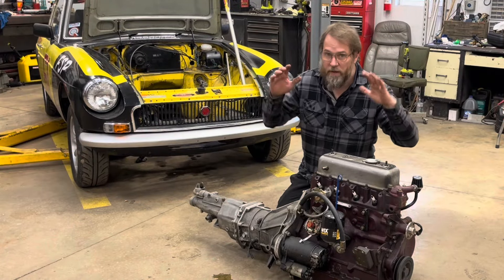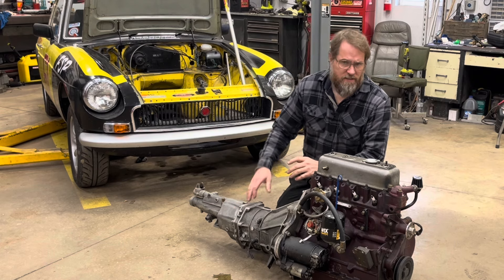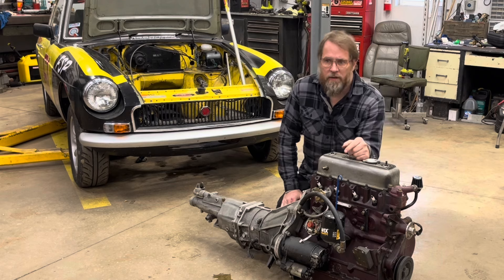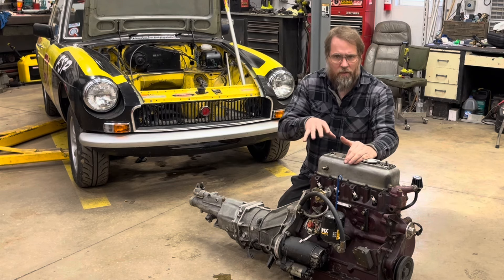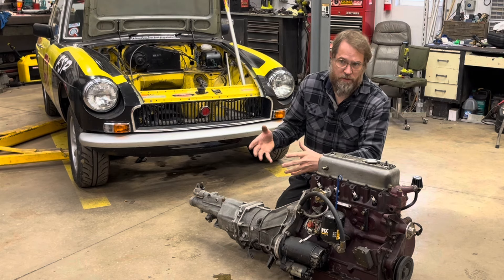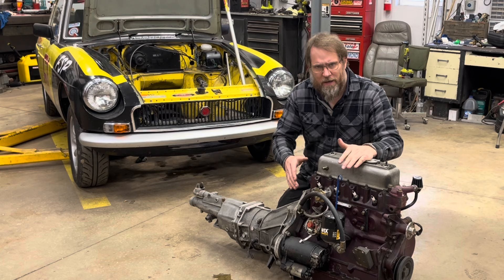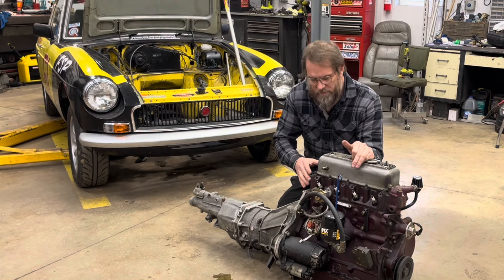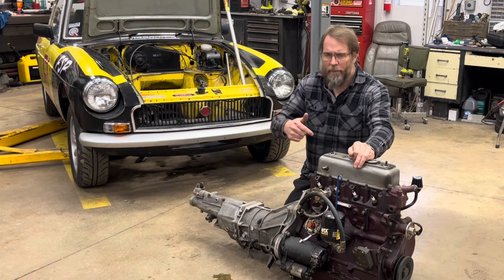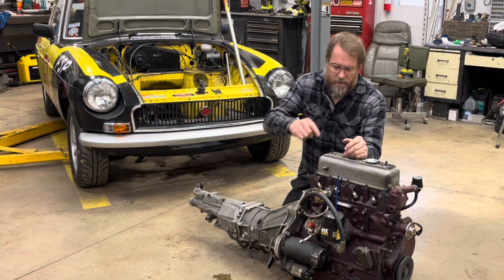Some of you already know that this was just a used engine that I threw in the car to get it running, because I was getting ready to go out for a season of autocrossing for the first time in years. But I had problems with my old engine - it had bad lifters, a broken main cap, every bearing was showing at least some copper, the oil pump was trashed, and I didn't have time to actually build a new engine. So this engine had originally come out of my V8 project; it had been sitting for many years, I knew nothing about it, hadn't ran for a long time. We threw it up on the engine stand, dropped the pan on it, took a look - the bearings looked okay but the cam was trashed. We pulled the head and the bores looked okay.